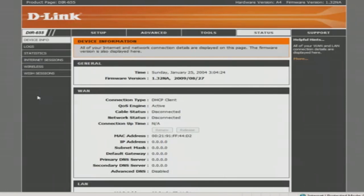When you first log into the router, this is the screen you're going to see. You've got options on the left and you've got options on the right. The first thing we're going to do is change the administrator password. Then we have to add encryption for the data. We also have to change the SSID or the broadcast name of the router. So the first thing we'll do is change the administrator password so not everybody can log into your router.